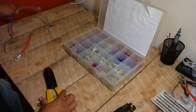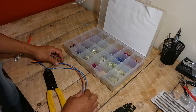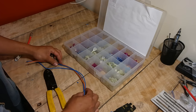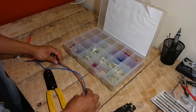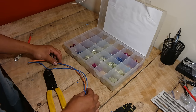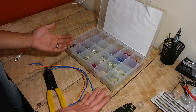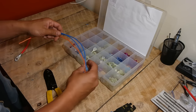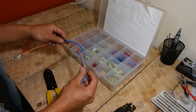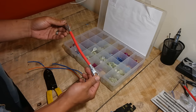The wiring in your tractor — most everything runs on a low amp, like 3 or 5 amps or under. So you can get away with using 16 gauge, 14 gauge, even 18 gauge in a lot of applications. Everything is a short run too, so there isn't really a lot of resistance. What I personally use is 14 gauge wire for everything except for the battery connections. For battery connections, you want to use a heavy gauge, 6 gauge wire.